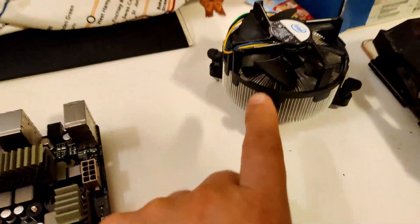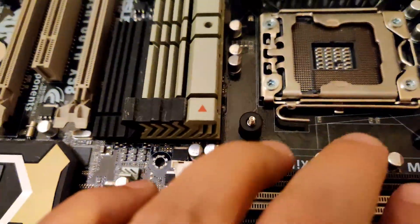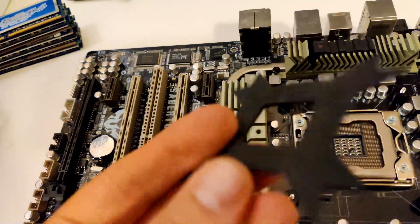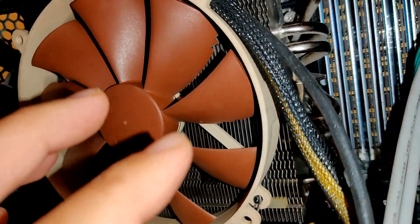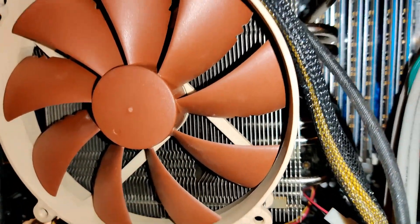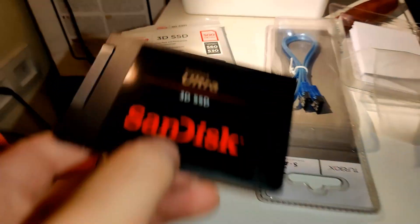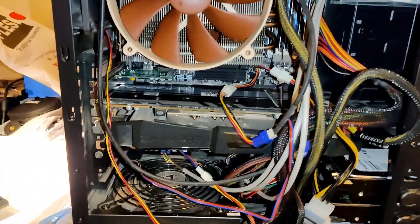Some changes in the plans guys — I decided not to install the stock cooler, because I'm gonna clock this Xeon to at least 4GHz. So I'm going to install the beast again. I'm just mounting the mounting points now. I had to remove this adapter on the backplate, because it was used only for the LGA 775 socket — this one is a different socket, I think 1366. So let's go for it. We are now at the end of this big exercise, and I have decided to leave the big Noctua here, because I am already clocking my Xeon W3550 up to almost 4GHz, and I also clocked the RAM. I actually decided to take things to the next level — I bought this SanDisk 3D SSD, 500GB, and I'm going to install it using a SATA 6GB/s cable, put it in this case, and hopefully put this whole rig together.